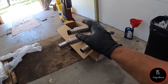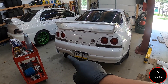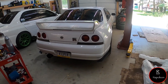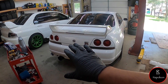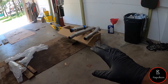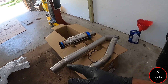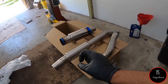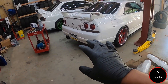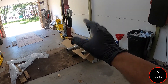I'm going to try to include exhaust clips from the last time we took the car out, just because a while ago I actually cut out the resonator in the center of the car — I needed it to be a little louder. So this is a continuation of that. Let's get this bad boy installed. One thing I had no idea about is that any oils on your hands on titanium will actually stain it, so I'm going to wipe everything down when installing and taking the old exhaust off. Let's move the car and get it in the bay.